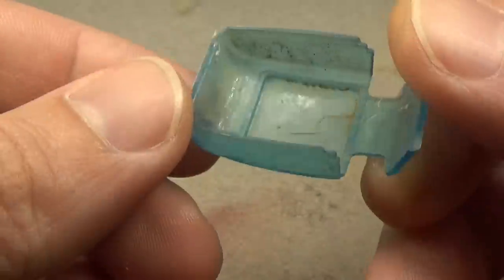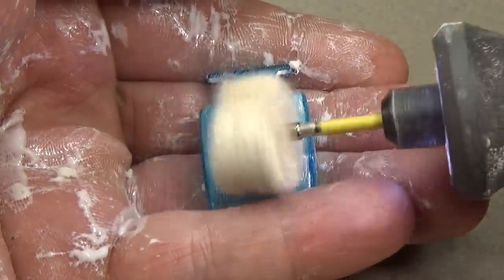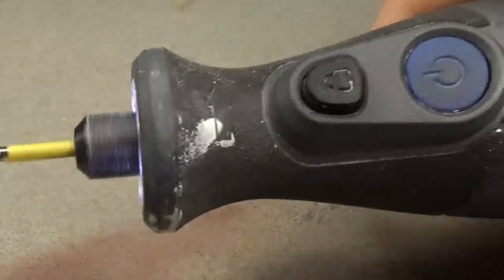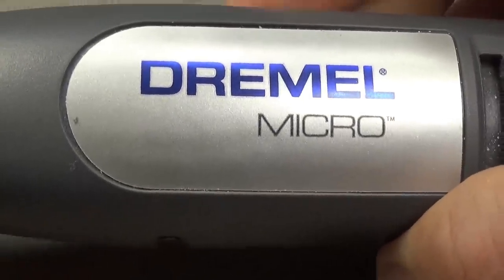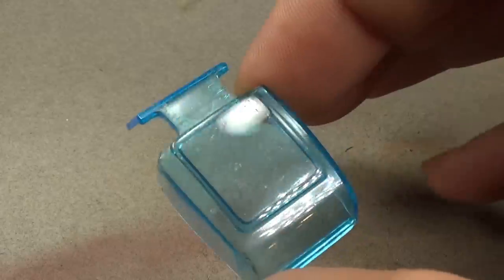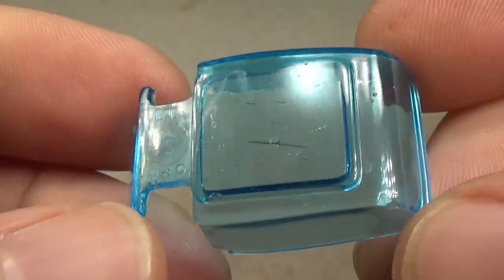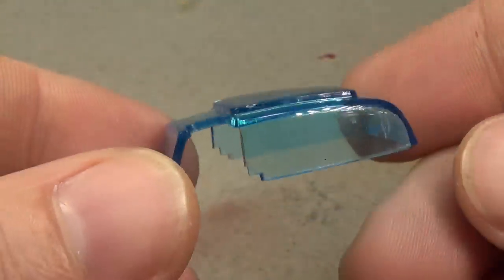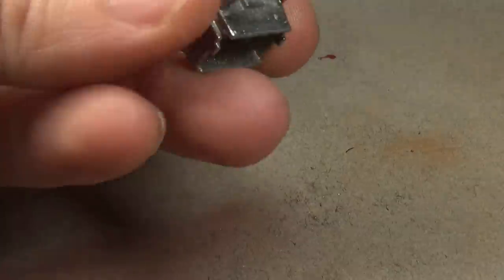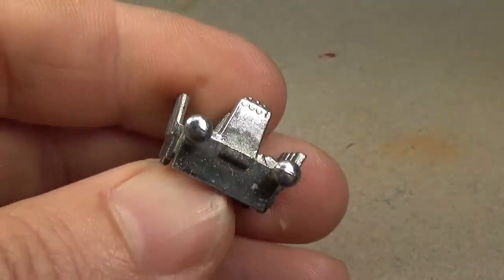Taking a look at the windshield, I think I see a crack in the roof, but it's hard to tell with all the dirt and grime, so I'll wash the plastic with dish soap and water and then polish it with the Dremel and a buffing wheel. I get asked a lot about the Dremel I'm using — especially this one with the built-in LEDs. This is a Dremel Micro, probably my favorite Dremel to use. It's super light and battery powered. The only complaint I have is the battery is non-removable, so once it goes the Dremel is trash, unless you hack out the old battery to replace it. That said, I've had this one for several years using it weekly and it still seems to be going strong. After polishing the windshield I'll wash it again with soap and water and dry it with a microfiber towel. I also switched over to a polishing wheel to polish the headlights a little bit — this is a restoration and not a custom, so I just wanted a slightly polished surface.